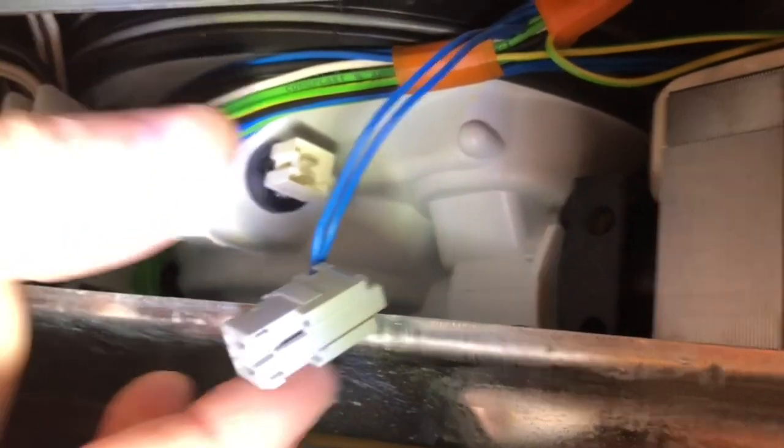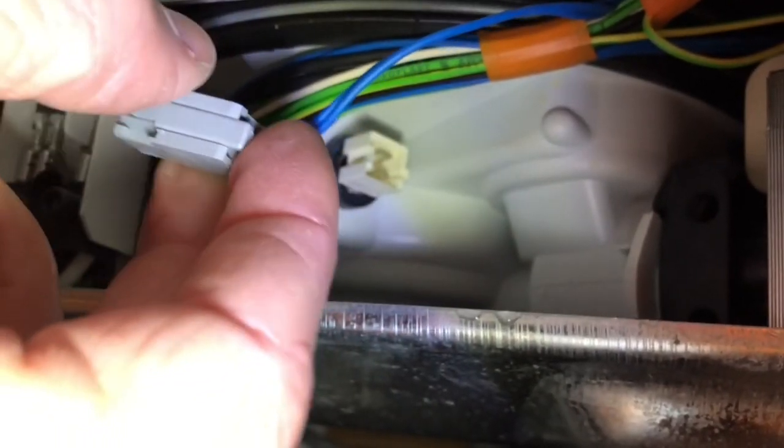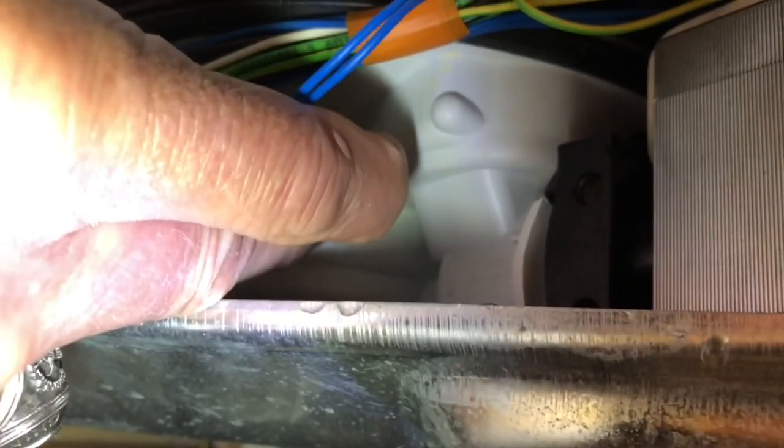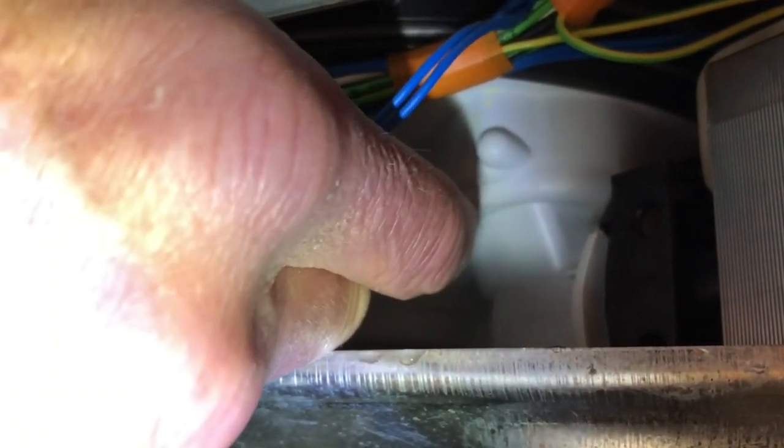On this dishwasher, it actually wasn't the dishwasher causing the fault, but it was the water heater stuck on full blast, and the water temperature coming in, instead of 120 degrees Fahrenheit, was 140 degrees Fahrenheit, and that caused the error. So it could be something to check. We noticed that the water heater pressure relief valve was shooting water out, and the water heater was just stuck on full blast. Could be what's causing your Miele dishwasher to have the first 5 program lights flash.